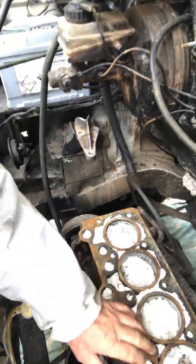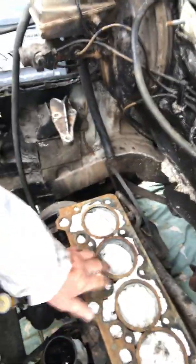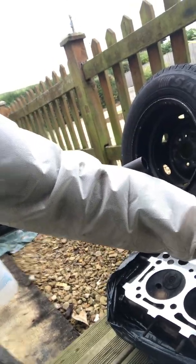When you're doing the block, there's a very good guy on the website, a bit religious in style, but I don't mind that, he's very good. Looking down here, fill out all the channels, using a basting thing take out all the water, fill all the channels, and then rub down backwards and forwards, up and down, using some sort of block arrangement, and keep testing. When you're testing, of course, there are different ways of doing it. You need a good metal straight edge, and you slide your feeler gauge.